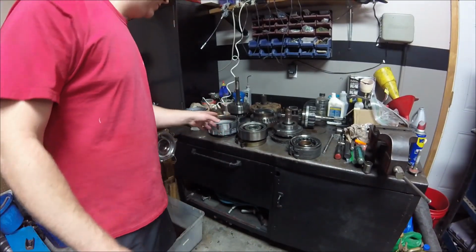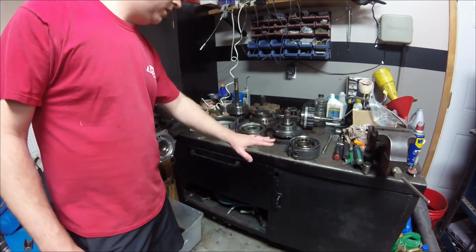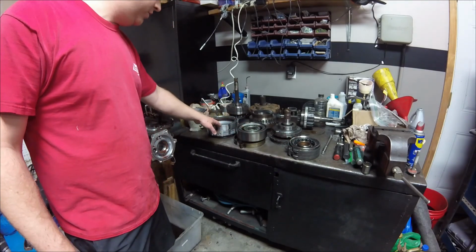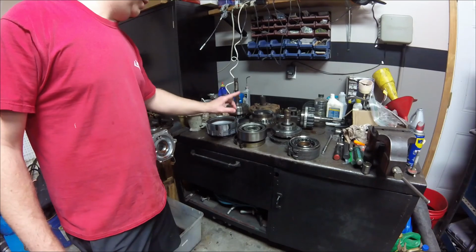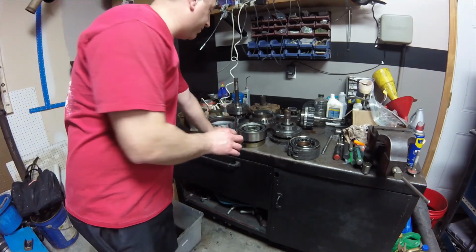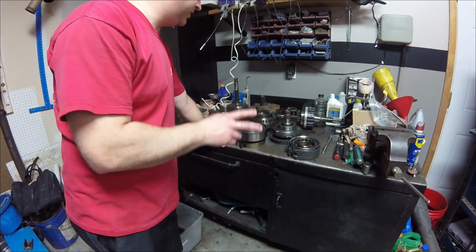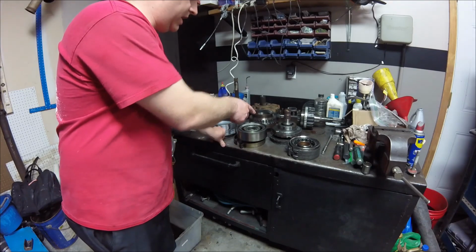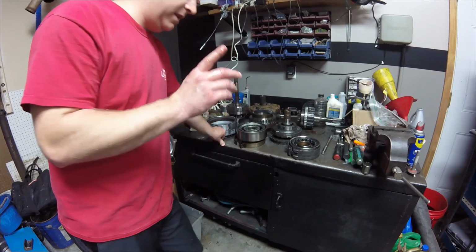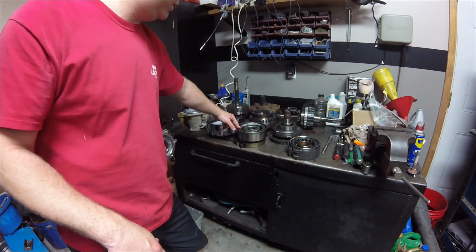we visit this transmission, we're going to take apart the sub-assemblies. When we get into these sub-assemblies, we're going to do each one individually, and we're going to take a look to see if we see any problems with each one. The only one I'm actually concerned with right now is going to be our intermediate clutch, which was for second gear, because those are the ones that had the clutch plates that looked like they were a little burned. However, in all fairness, I didn't take apart the other ones yet. I haven't looked at those clutches.